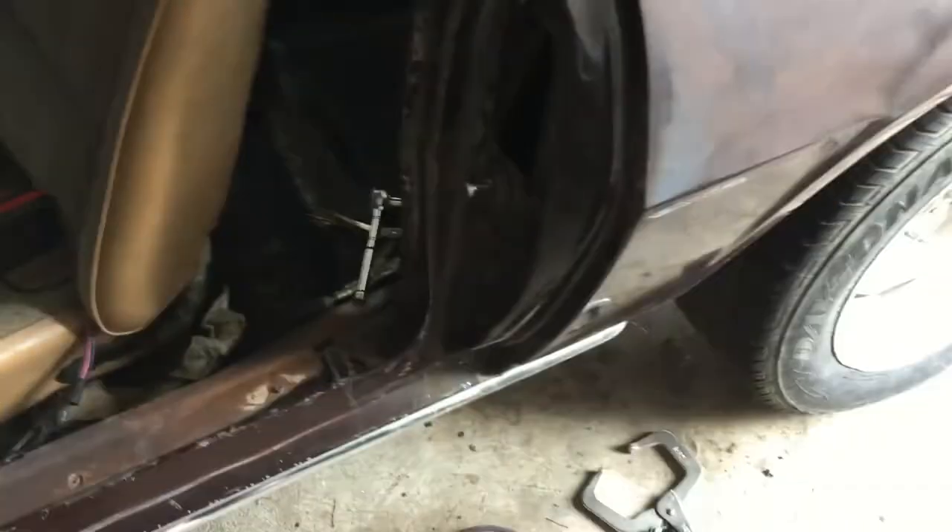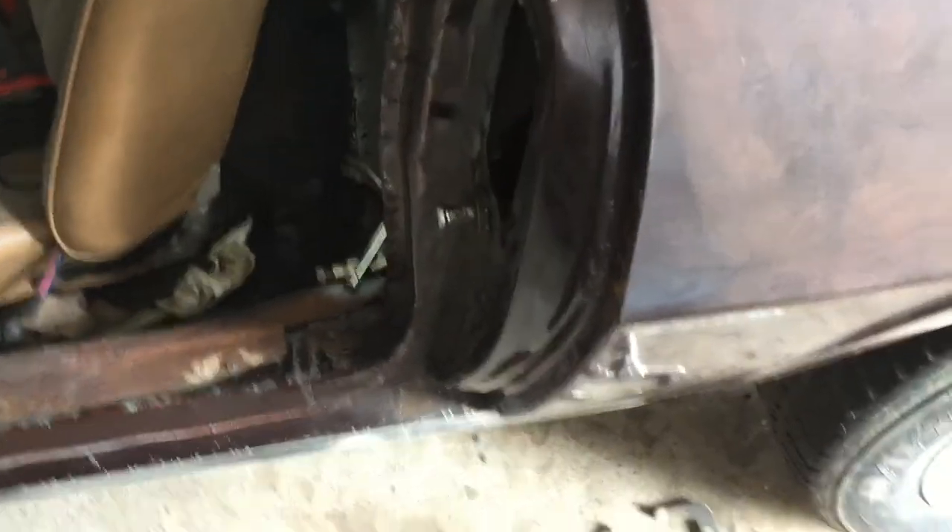I'm going to do a trial run on opening and closing the door - see if I can get some adjustment out of it. I think I should be able to now. Okay, so here we go - got the Camaro, I got new hinges on. It sure makes a pretty loud popping noise. We're going to try this and see what happens. There we go - some junk falling out of it. You can see how bad - the handle still hits. Before I had to kick the door open, now I just have to reach inside.